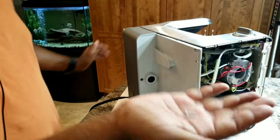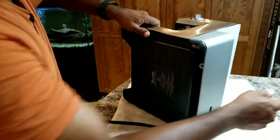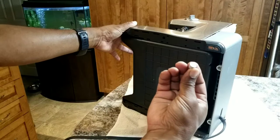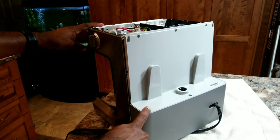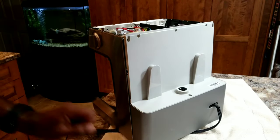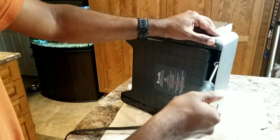I got that screw out, and I see what the issue is here — there are two more screws to be removed. You may be wondering why there is no clip-type plug here. There should be three of them for the BES 870 XL, but this is the first generation BES 870 XL so it doesn't have the extra two screws in that location — instead they have them at the bottom, right there and there. So that makes sense. Let's take it out.